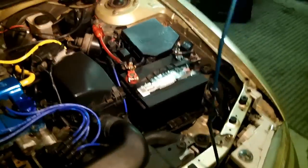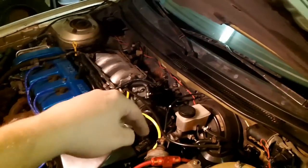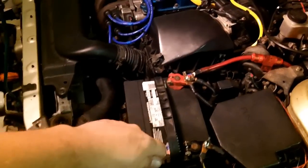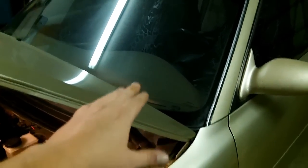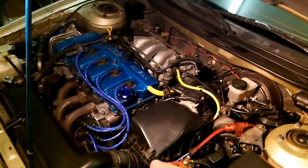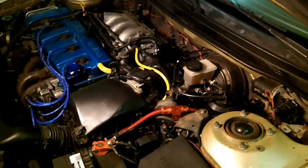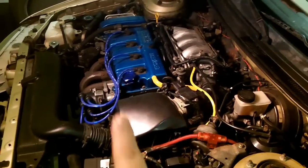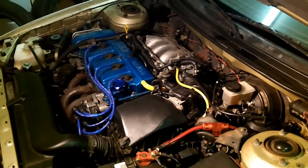For base idle speed: as long as you're in diagnostic mode, you can come over to the air adjust screw and adjust it with a screwdriver to take the idle speed up or down. If you cannot get your idle speed within a certain proximity, the ECU cannot compensate enough to correct it once you exit diagnostic mode. Once out of diagnostic mode, the ECU will automatically compensate and set your RPMs to the correct level. If it cannot compensate enough, that's when you have idle issues — which could be due to vacuum leaks, valve timing, burnt valves, a dirty MAF sensor, or a bad engine coolant temperature sensor.